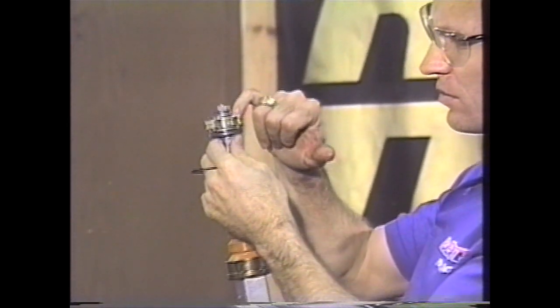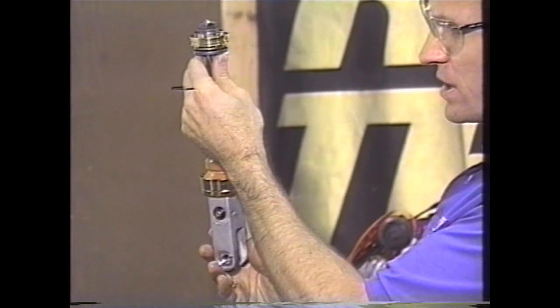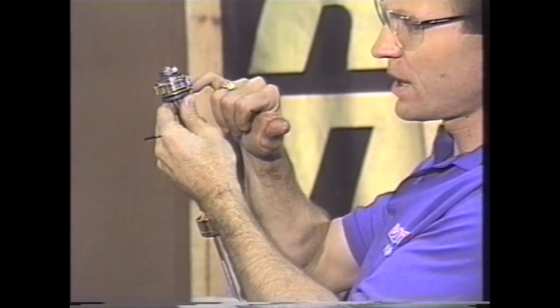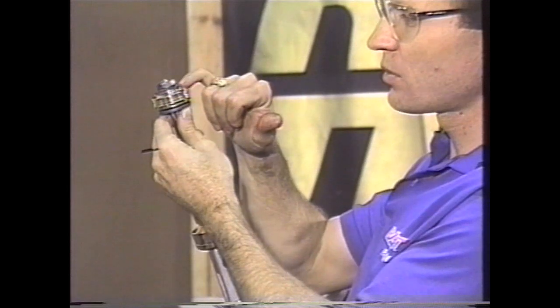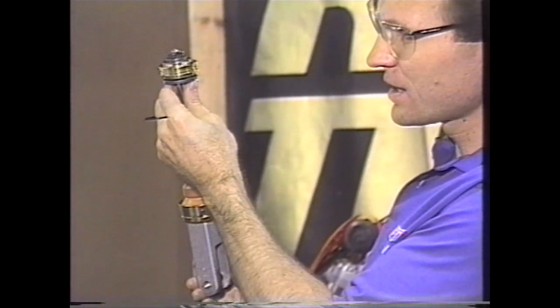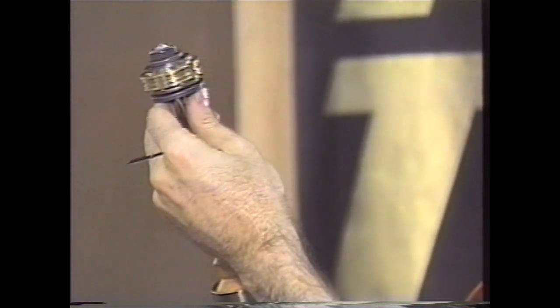Basically this is ready. What you want to do is double-check it — hold it up to the light and look for your gaps in your crossovers. Check the gap between your low-speed and high-speed compression, and your low-speed and high-speed rebound. If there's a little dirt or a lip there, that will show up by smashing that gap down. See how everything is sitting against the face of the piston, making sure that you've got the piston on properly in the right direction.